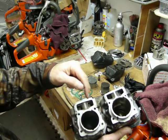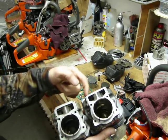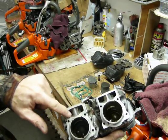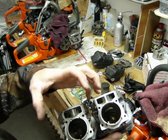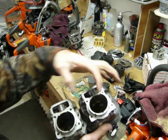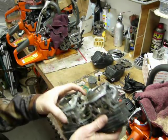They're square, about 12.5 millimeters or so. On the 562, they're oblong. They're about 14 by about 12.5. But anyway, like I said, I like this design better. The transition isn't as abrupt as what we see in the 562. I have no idea why this cylinder is bigger distance-wise, other than we're trying to keep the saw short.